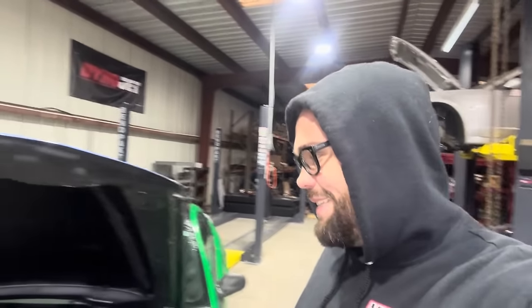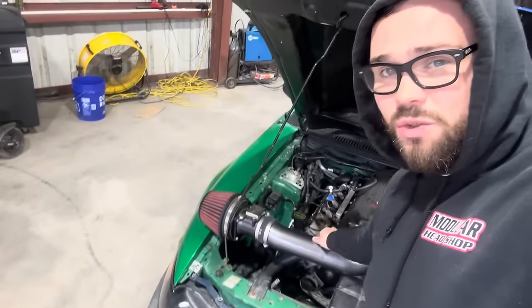We're hoping to see maybe 10 horsepower gain. Could be no gain. We really don't know. Next test will be a little bit more scientific. We're gonna swap out this intake that doesn't fit. We're gonna try to put the 05 plus slot style MAF on and see if the larger intake will make more power too. And I do wanna test with some E85 later and maybe a DW300 pump, because we're probably getting close to the limit of this pump, but we're gonna see what we can do.